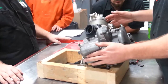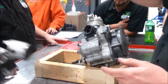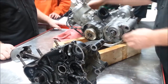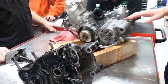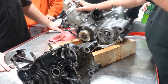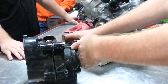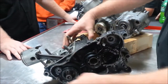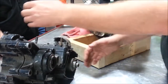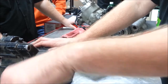Give me those engine cases behind you. I got this donated because it's a rare oddball one that's not real common — it's a right side drive. So if you look at this, do you see how our sprocket would come out this side? This is 99.9% of all dirt bike and four-wheeler engines out there, so that's what we train on. But on this one, the transmission shaft comes out the right side, which means the clutch and everything's on the left side and your ignition is on the right side — so it's backwards. They chose this on either a three- or four-wheeler, a Honda. I think it was a three-wheeler that had a right side drive. Really rare.